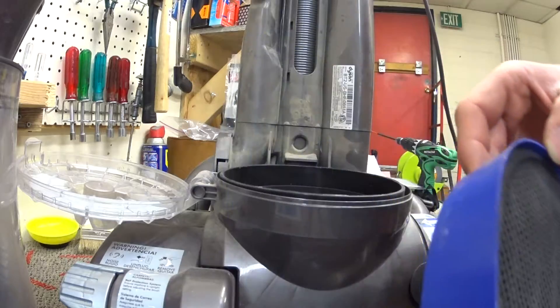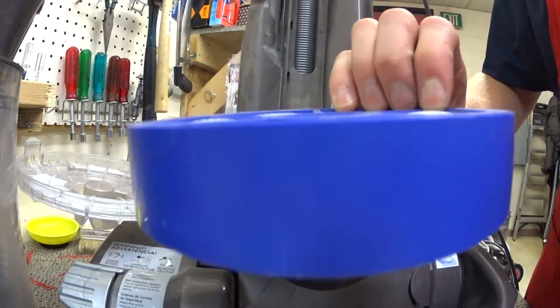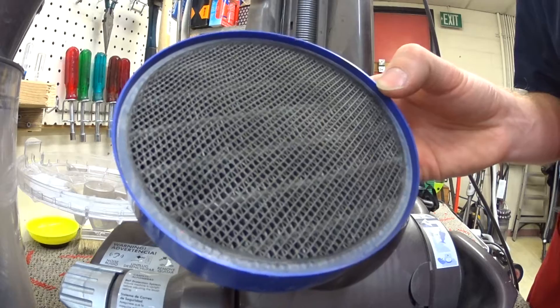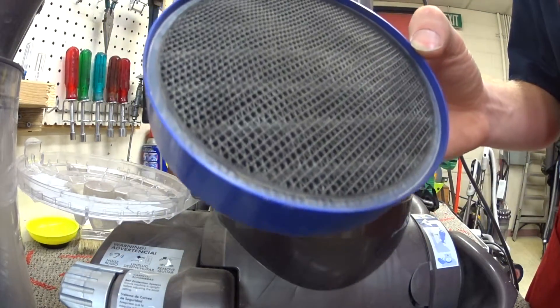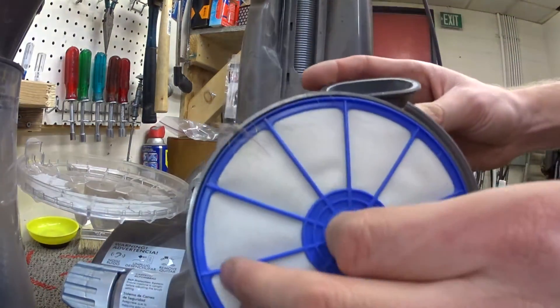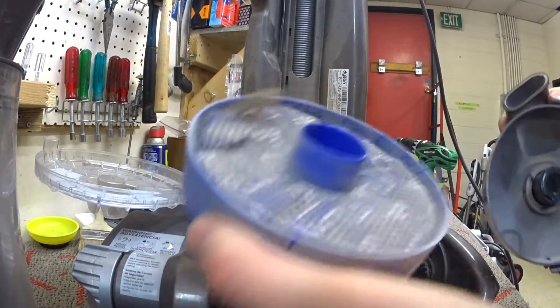On the side that does not have the gasket, it blows clean air, but on the other side it's just escaping. These are meant to be washable, but I guarantee you if you rinse this out with water it's going to make it worse, because the hardness of the water is going to get stuck in here. I always recommend replacing that every six months or so. Of course you're supposed to wash this other filter every time you vacuum — and that one is filthy.